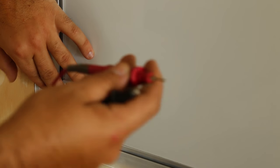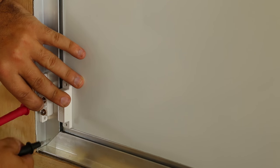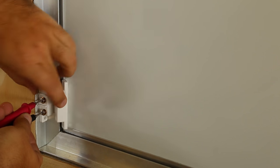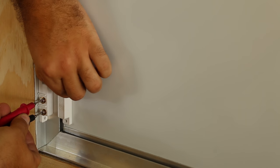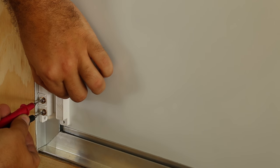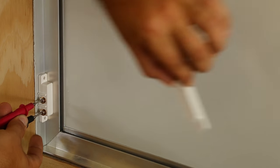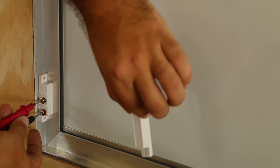I've got a little multimeter here to see if this is a close enough proximity. If I put these together I get no signal. If I open the door it turns it on. So I think this is what I'm going to do for windows that have this three-quarter inch trim around it like this.